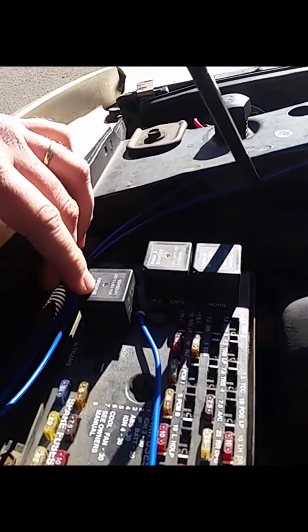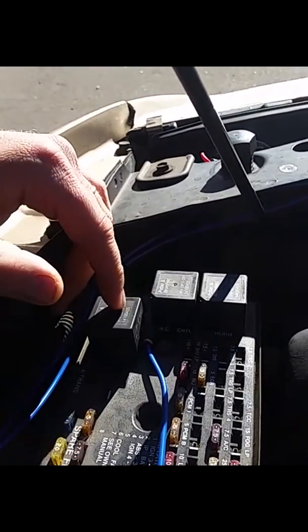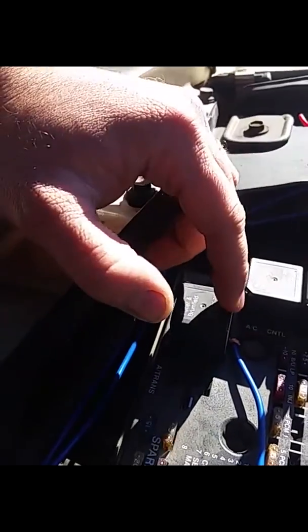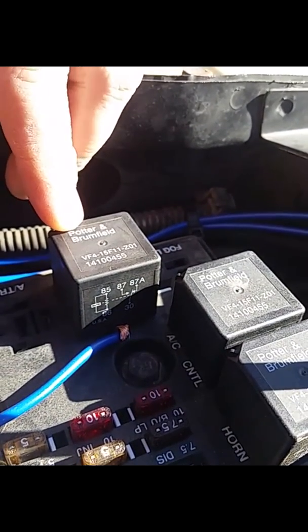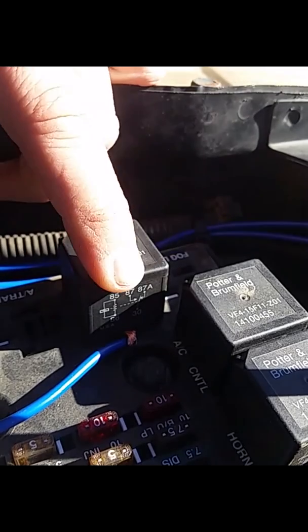The way I have it wired up, I wanted simplicity. I have it wired straight up to the relay that controls the fan itself. I didn't want it to be a crazy wire job, and the relay is switched on the negative side anyway. So one wire goes straight down to the chassis and the other goes to the relay on the negative side of the switch leg. I have it hooked up to the 86 side. The 85 side is naturally hot, and the 86 side was the switch leg from the computer.